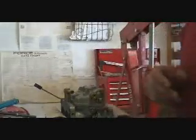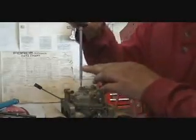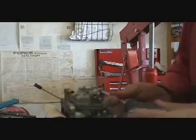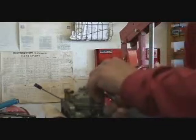So again, we look for loose bolts, loose nuts, loose screws. Watch for little tiny washers. The Yamahas have little metal washers that are very easy to lose. They need to go back in because that's how they seal. They don't use the carbon fiber washers that Johnson and other manufacturers use.